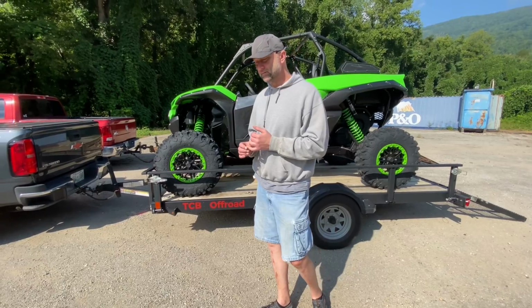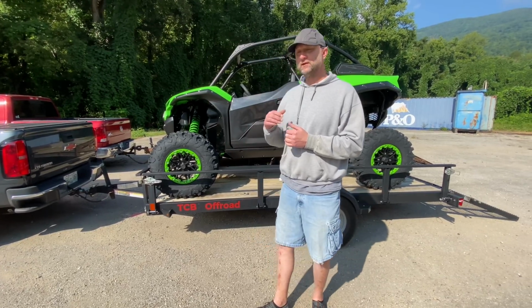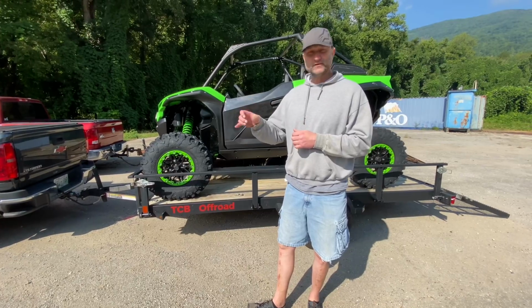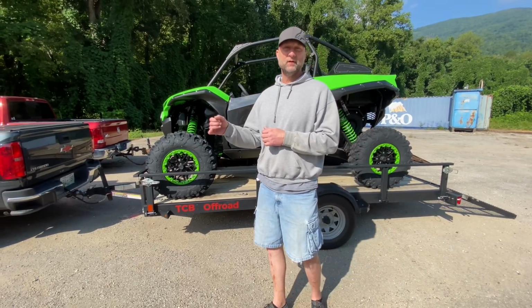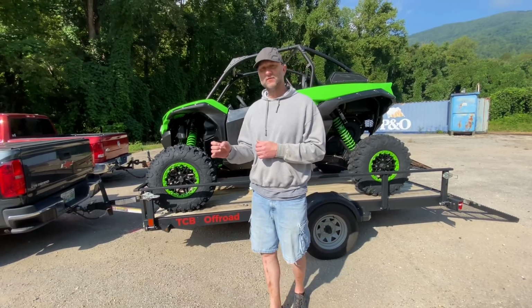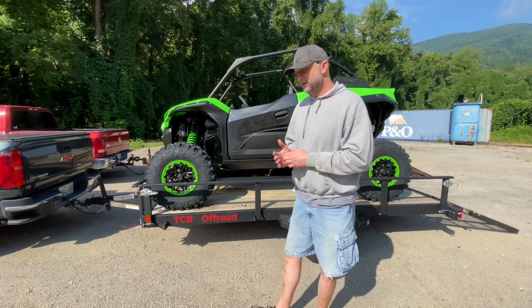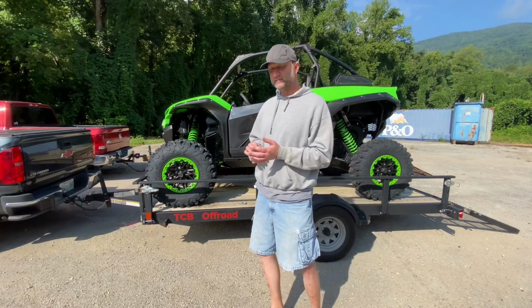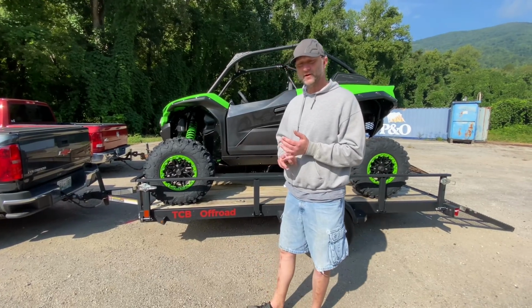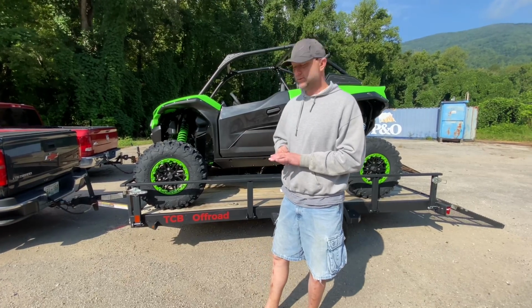So I teamed up with a buddy of mine a week or so ago who has a little bit of common sense. And I actually looked at my steering rack when I was turning it, and what he noticed was my steering yoke had a massive amount of play in it, and it was pretty much worn out. So we've narrowed it down to my steering yoke and my steering shaft. I've already got one ordered. It's at the dealer now. All I got to do is go by and pick it up.